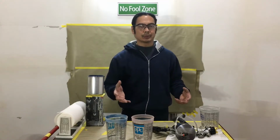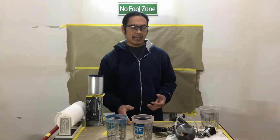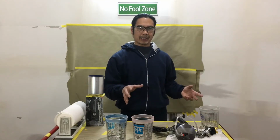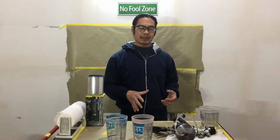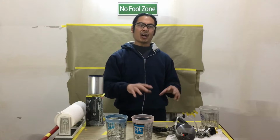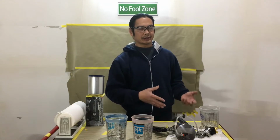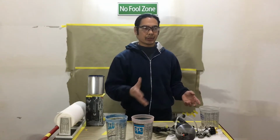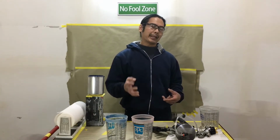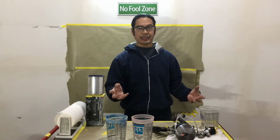So you need to warn your customer, hey, if you start to experience certain things. A lot of this collision work is get it in, get it out. Sure, the car goes in a booth, gets sprayed, the temperature goes up, bake it. It might be dry to handle, but that stuff is still off-gassing. And your customer gets the car within 4 or 5 hours, because some manufacturers say you can do all this within 3 hours and deliver it to the customer. The customer gets the car. They might not show serious signs of exposure, but they're still getting exposed.